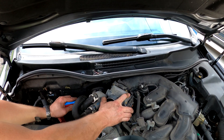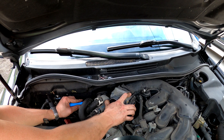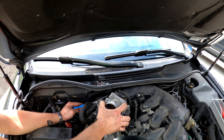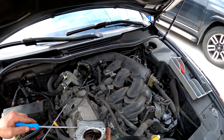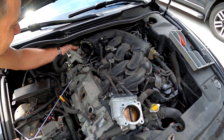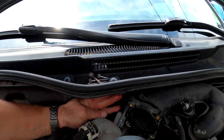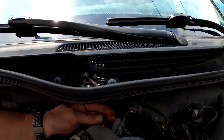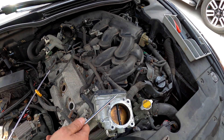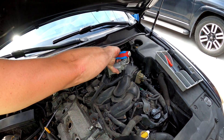We're gonna see if we can work this flat screwdriver all around it. Wait, why the hell is there fuel in there? No, that's actually coolant — this actually has coolant inside. I thought it was a vacuum line, but see the coolant leaking? They're running coolant through here to cool it down. We're gonna get this out of the way — just gotta be careful when you close the hood. Don't close it all the way or it's gonna jam on it.